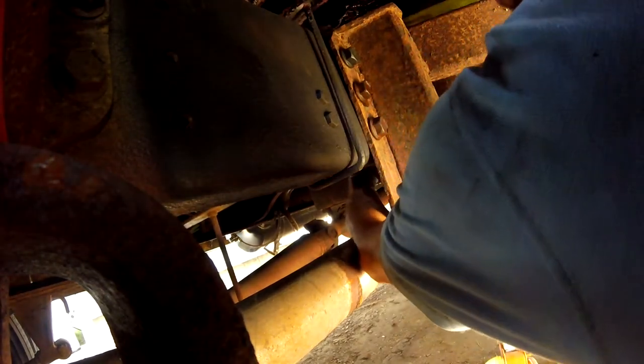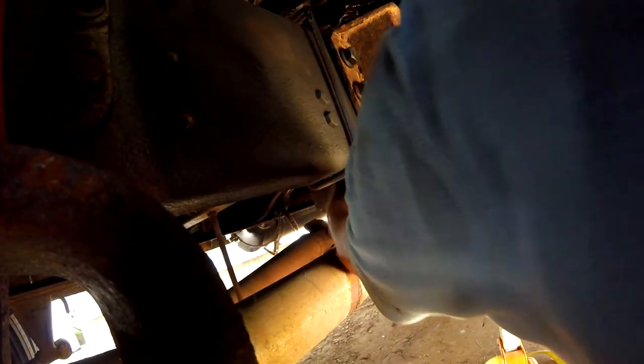And once the temperature breaks during the week, I can get back out here and start working in this thing again. Yeah, no kidding. So you don't have a way to run the air conditioner right now? Yeah, I need to go get a new RV cord. I tried hooking it up to my household circuit, but I just keep blowing this circuit. It kept blowing the garage circuit also. So yeah, we're going to need to bust out the generator.